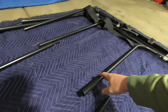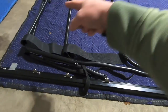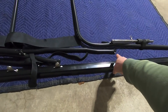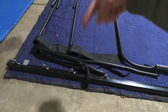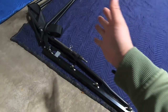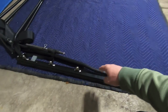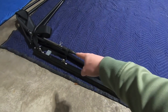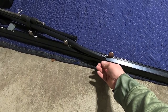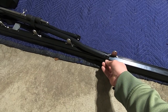Connecting the sections is super simple. There are little push pins — the section just slides right on top and attaches with a little hole so you know it's installed correctly. After we connect all those together, we're going to bolt it to the bed rails. There are little hex head screws that fit right around these little tabs. Use your hex head wrench, tighten them up, and that's what holds the hoop section to the bed rails. I went ahead and connected all the hoops for each side.